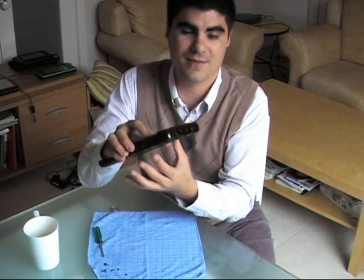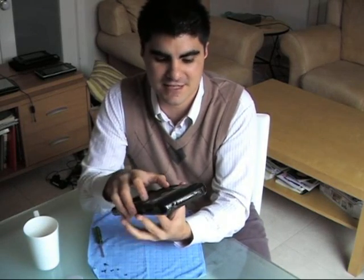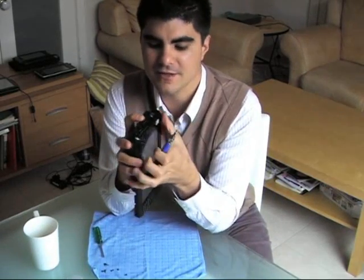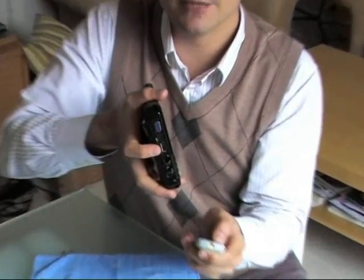Now that we've got the exposed Q1 chassis, the hard plastic back case does not just pop off at this stage. Samsung has designed a little flap to hide ports — it looks nice ergonomically and it protects from dust. Let's lift up that dust protector and grab our blunt flat head instrument. Between the VGA and the USB there is a little pressure clip. What we want to do is stick our blunt tool in there — I chose blunt so that we don't really hurt the Q1 itself. You can see the chassis now comes apart slightly; it's a very soft push. Whenever you're upgrading any computer parts, always use very subtle, soft movements — they've all been engineered to sit precisely together.